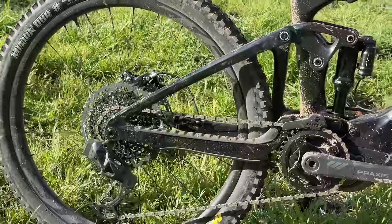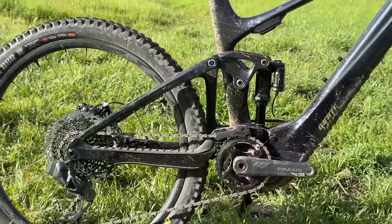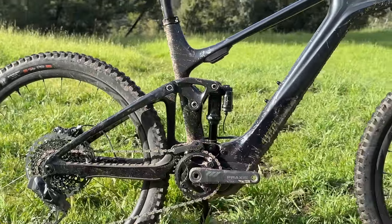Totally. And kind of on the motor, still talking motor drivetrain-ish, I think it's the only bike that came with a 36 tooth front chainring, which I think is what all e-bikes should have. Our drivetrains are built around human power, and then when you have that assist, it ends you way lower in the smaller end of the cassette.